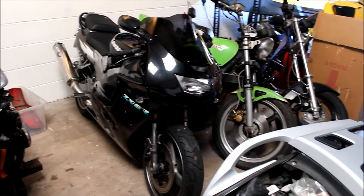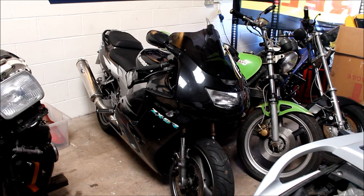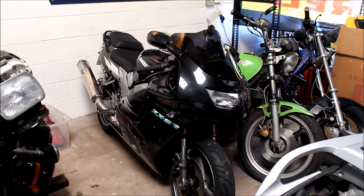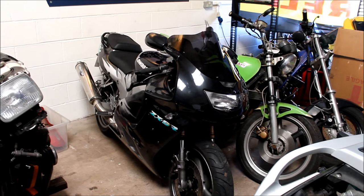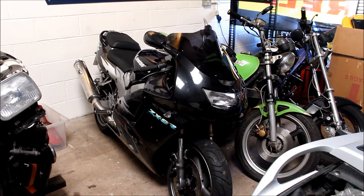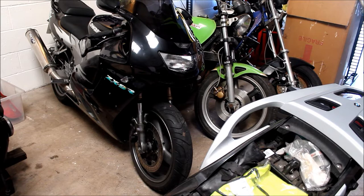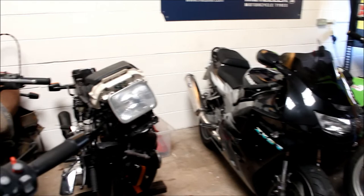If I come around this side, it's actually quite a nice bike - it looks to be in good nick with the original pipes on it, no real corrosion. Next to it is another nice bike which is the donor: a Kawasaki ZX9R. The reason why this particular bike is quite popular as a donor is because the front forks are quite long in comparison to other sports bikes with upside-down forks - these are quite long, so they work a bit better on older bikes. Whilst the wheels, forks, and brakes are coming off it, the engine is a possibility to go into one of the lads' ZX7s - all right, an extra 30 horsepower! It's even got a Maxton sticker on the front forks, which implies it's had quite an expensive conversion done to it. Aiming for April - spring.